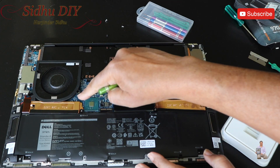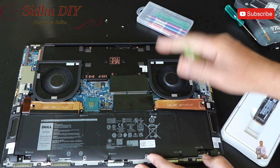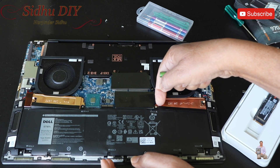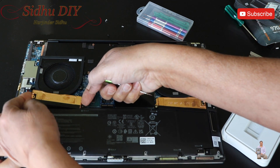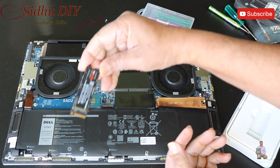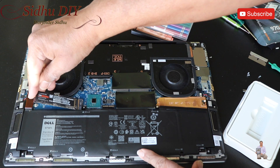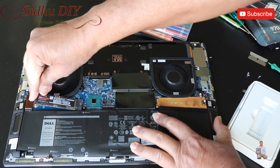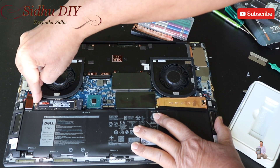Make sure you don't lose the screws. One tip I want to share: this SSD slot is right under the battery. It's a good idea — there is another screw for the battery. You loosen that screw, then you just lift the battery like this a little bit and it will come out easily. So now we get the SSD. It has only one orientation, so it's very easy. You insert it in, press it all the way in, and then push it down just like this. It sits right there.